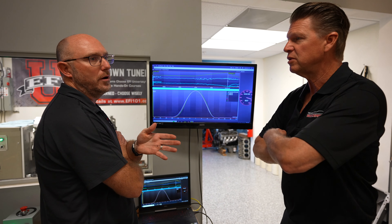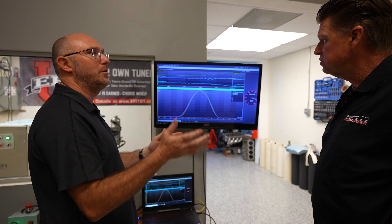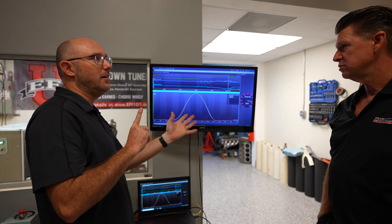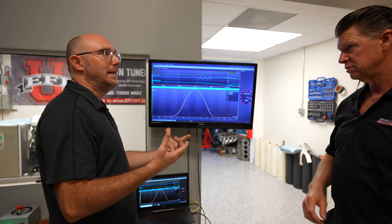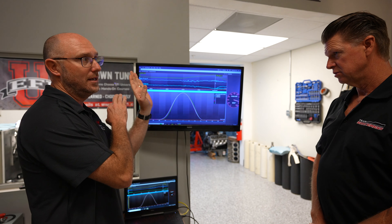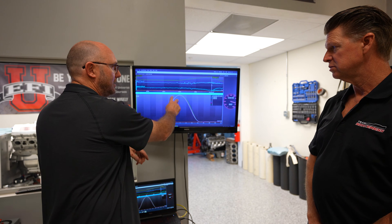The biggest thing we wanted to change initially was to stop all the bending and deflection of the valve train. We knew from the beginning — from the first day in Vegas — the system is not holding the rocker arms stiff enough to the cylinder head. So when the pushrod goes up and tries to make the valve open, instead something in the system just bends or flexes, and that's a loss of lift we get initially. However, as we go throughout the lift curve, whatever we did by bending is going to come back with a vengeance, like a diving board. What it was doing before was tossing it way up over the nose — we call it the McDonald's — like these really wobbly lines.